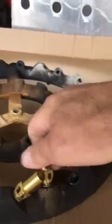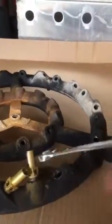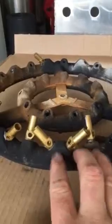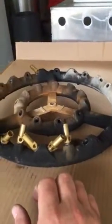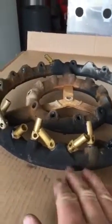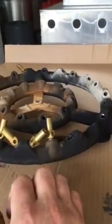I'm obviously not going to show you every single one, but that's what I'm doing — tightening them down with a wrench, going around the whole thing. This stuff is high temperature, rated for over 400 degrees, and the lower section of this burner really won't ever see that kind of heat. It's a quick fix — I was looking at buying new burners, which run about a hundred bucks apiece. There's my pile of jets right there. You put these in with JB Weld and they're not going anywhere — guaranteed no flame blowing out the bottom.